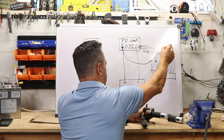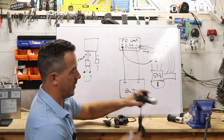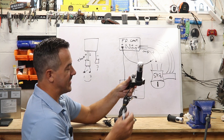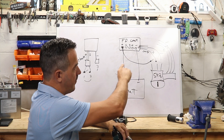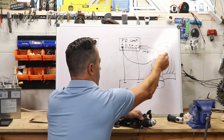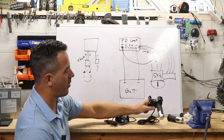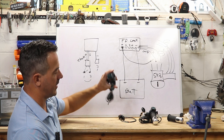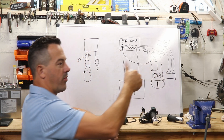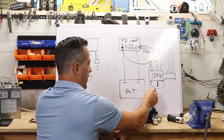The throttle connections are gonna be a negative, a plus five, and your signal wire — that is how you're gonna get the potentiometer of your throttle information to your controller through those wires. Since the negative is common, you'll only actually have five wires total even though I show six, because the two negatives are common and you don't need that redundancy. So that's your five connections for your throttle with your key switch with your voltmeter. Or you can just have a switch — if you wanna put a little thumb switch, like the gas engines' on/off switch, you would just wire that switch right here.